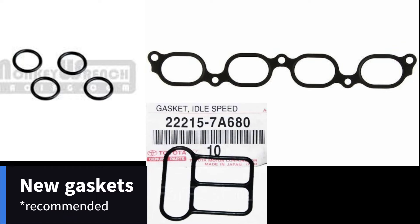Now that you're ready to install your new parts, this is a great time to look at your acquired parts — your intake manifold, throttle body, and injectors. You really want to strongly consider putting new gaskets onto the intake manifold, onto the throttle body idle air control valve, and definitely onto your fuel injectors if you're installing them. These parts are perishable and Toyota's service book recommends that whenever these parts are out, just swap the gaskets. I did this with my install and drove the car for another seven or eight years — it was flawless.